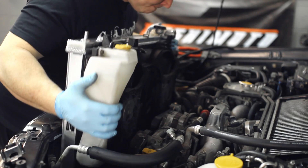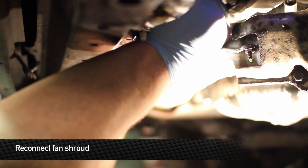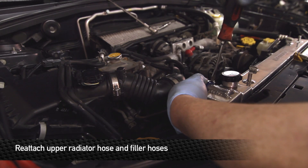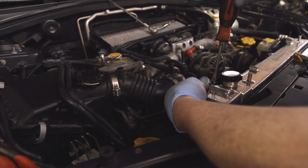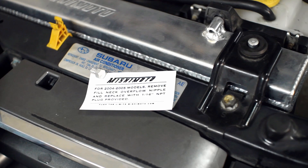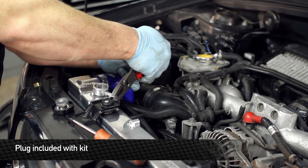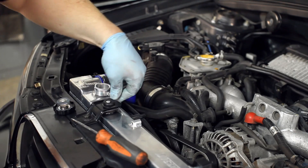When installing the radiator, make sure that the radiator lower pegs fall into the rubber grommets on the lower rad support. Next, install the upper radiator hose onto the radiator. If you're working on a 2004 or 2005 Subaru model, you may need to install this aluminum plug into the upper radiator water neck. This is for models without a water neck on the radiator as opposed to ones with it on the engine. For this particular model, we will be installing this plug.